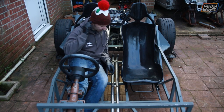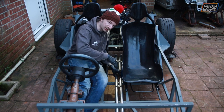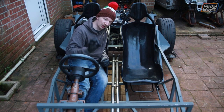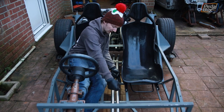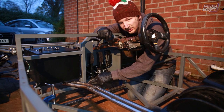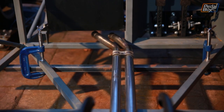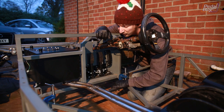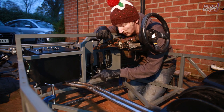With the seats in place and the tabs cut off the side, we can see that if we'd left the pipes on the left-hand edge we would have been really close to our seats and couldn't have fit the tunnel side wall in that gap. So we've realigned the pipes to run directly down the centre line of the car. The heater lines, being a bit smaller, can probably sit down the left and right, and the shift cables can run straight over the middle. Up at the front, the kink to the left in the MGF pipes is great because it lets us dodge our upright without needing a full custom bend. Now we just need to cut this crossbar down to size and weld it in between the two diagonal braces for our front mount.